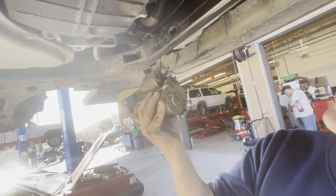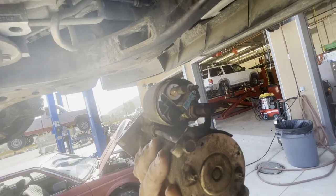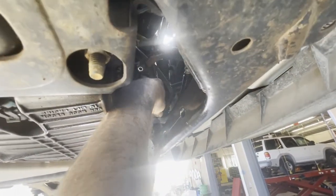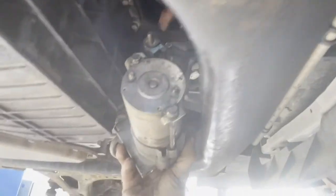When you go to reconnect this, you want to make sure that you hook the wires back onto the correct terminals. In this case they only fit really in one size — fits on one terminal. Sometimes there's a direction to them also. For example, this one up here has a little tab on the side of it. That tab is what locks it in place and keeps its position correct on the starter, so you want to make sure you line that tab up like it was originally.